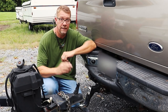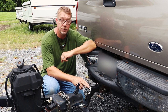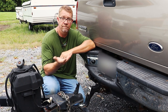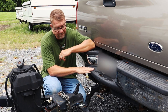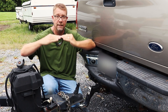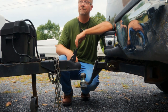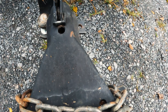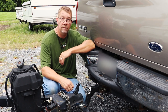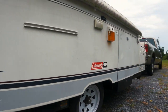If you're new to pop-up campers and you need to spec out this type of equipment, you just need to know the size of the drop that you need for your drop bar and the size of the ball that the camper takes. For the drop bar height, it's a matter of what truck you're using. On this F-350, a 6-inch drop works perfect. When you're all hooked up, you want the truck and the camper to sit level — taller trucks need a deeper drop bar, shorter trucks a shorter drop bar. For the ball, the coupler will have the size stamped on the A-frame head. Popular balls for Coleman and Fleetwood pop-up campers are 2 inch and 1-7/8 inch. This Cheyenne takes a 2-inch ball.